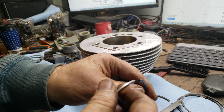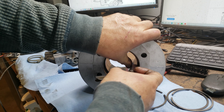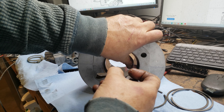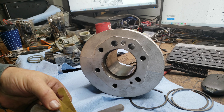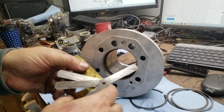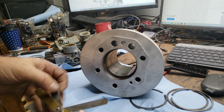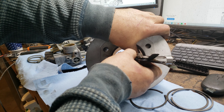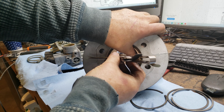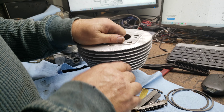Let's try the scraper ring. The scraper ring — this is actually kind of positive because the .45 doesn't go in at first. This should be between .30 and .45. .45 goes in and it actually has lots of friction. So that's a good ring.